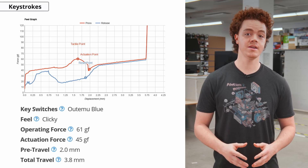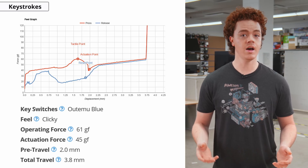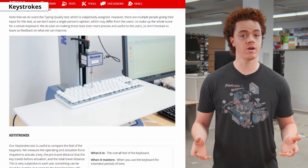Previously, we tested keystrokes using a single key. Ideally this should be enough to interpret how the rest of the keys feel, but this isn't always the case. Key switches have manufacturing tolerances so they don't always feel exactly the same, and even the position of a key on the keyboard can affect how it feels. So new for test bench 1.0, we now measure 8 alphabetic keys per keyboard and average the results to get what you see in the review, giving a more accurate representation of what it's like to type. However, the graph in the box uses data from one key only, as averaging graphs can produce a result not representative of any individual data. If you'd like to learn more about keystrokes and how we measure them, check out our Learn article.